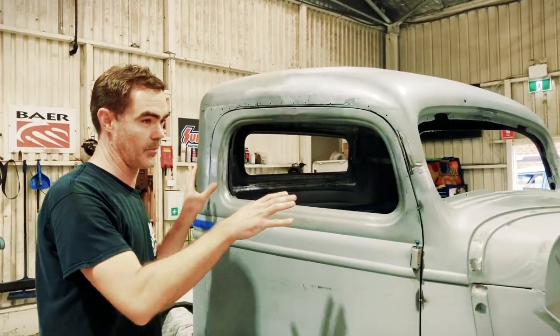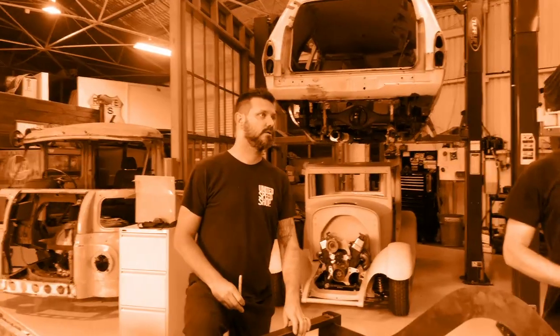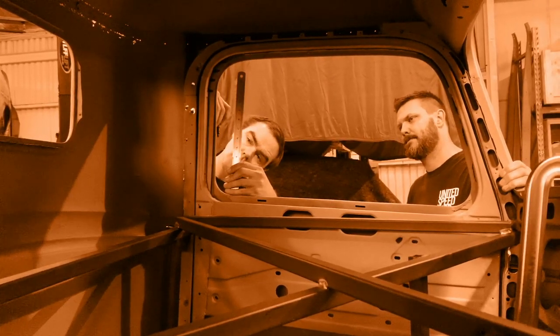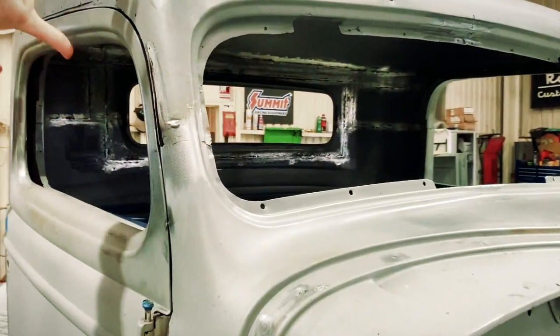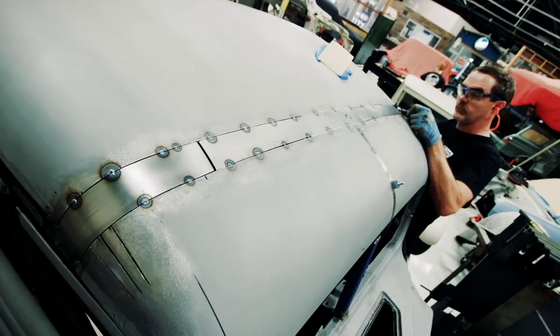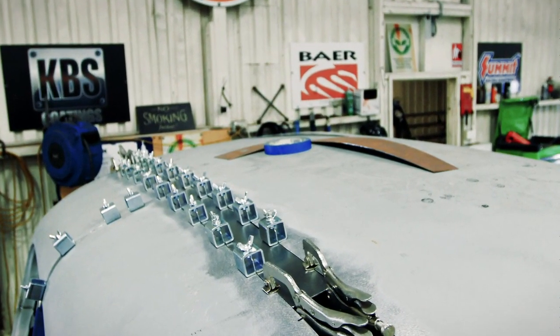I think in real world, the best idea is to get back. Ryan's got a good eye for detail and to dial them in, so he just stood back. We ended up taking 4 inches out of the B pillar, and we took 4.5 inches out of the A pillar. And obviously because of the taper in the screen, we have to split the roof sideways and then split the front and rear of the roof for the pillars to line up.